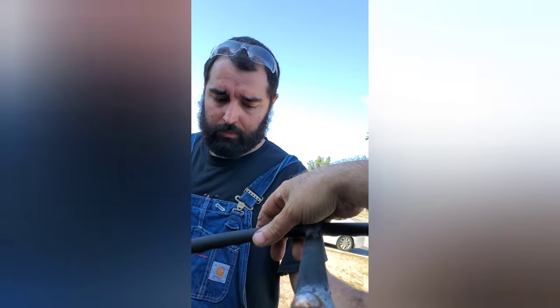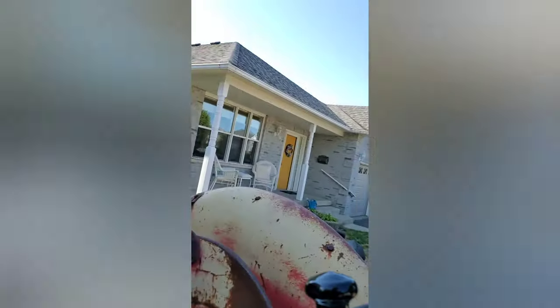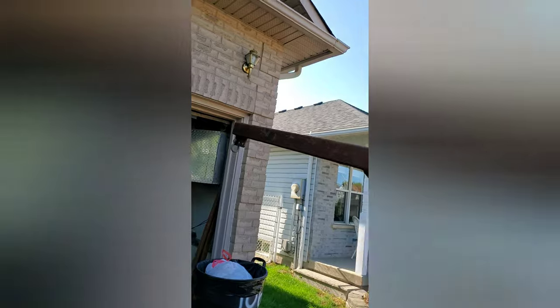It's weird, eh? Must be something going on to get the flow in the back, the flow in the diff. It's already milky, though. Yeah, I know. That's no good. That means there's a lot of water. I knew those were water droplets percolating on the gears. It's moist in there. There's no other way of getting it out. We'll put a water absorbing filter on when we get the hydraulic pack figured out.